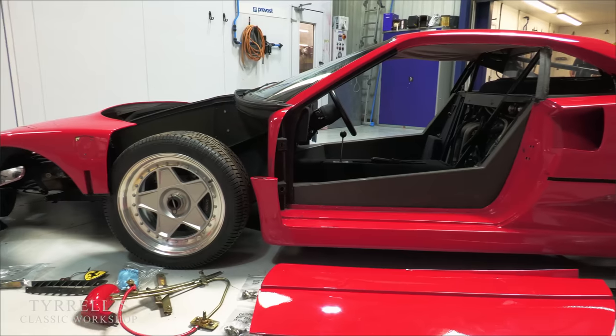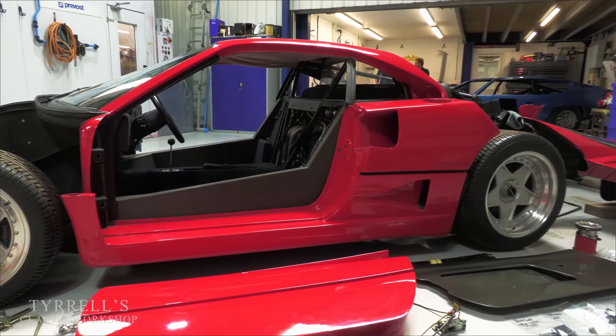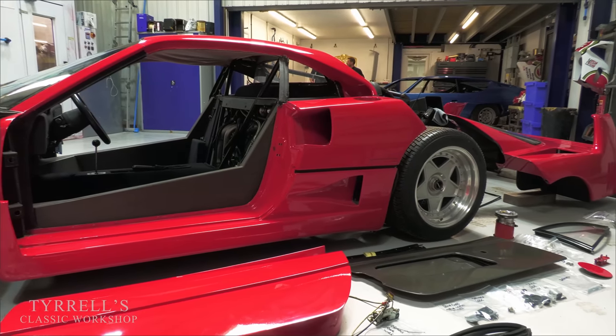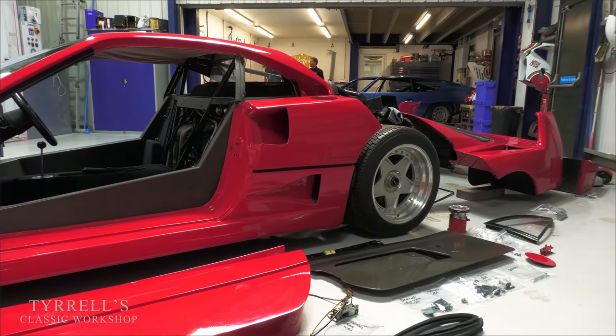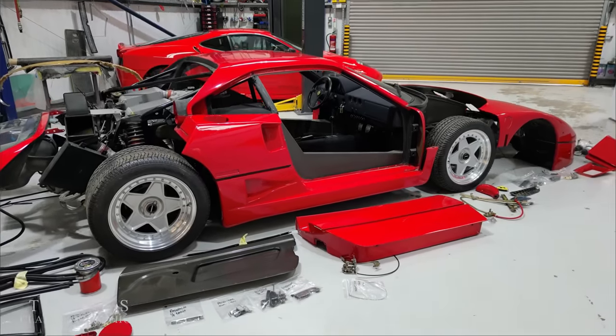The worst thing you can do. Because the turbos had overheated. Modern cars have water-cooled turbos, coolant-cooled turbos. And these just rely on engine oil circulating. So again, I'll say it again, I've touched on this before, but if you are lucky enough to own an early turbocharged car, let it idle for a minute or two before you switch it off. And obviously the same, as you say, if you don't pull in with hot brakes and... Not hot brakes, hot engine, no.